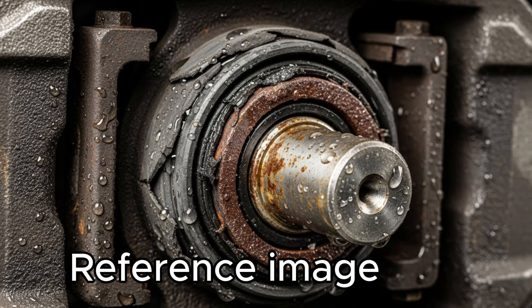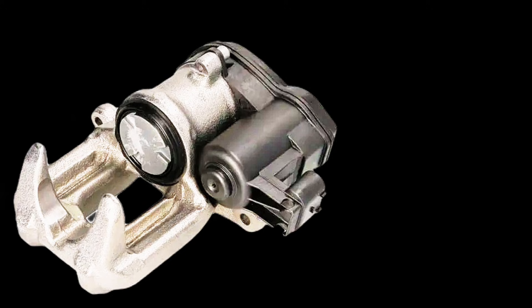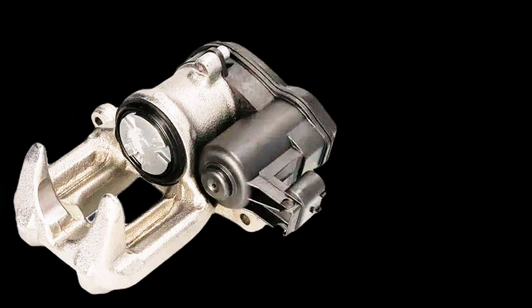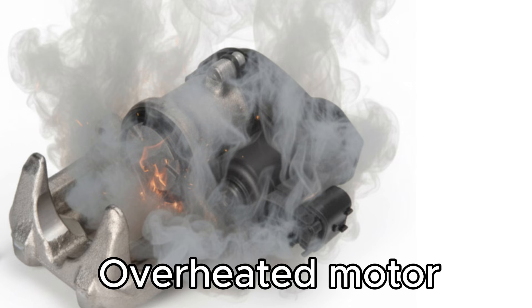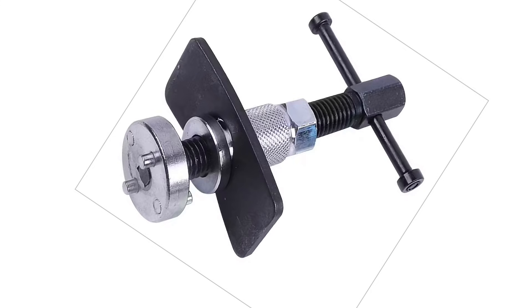You can get a bit of water in — as shown in this reference image — and then the piston can get stuck. But on this particular car, the piston was okay. The issue was the motor itself. The motor itself had become stiff with a lot of resistance for whatever reason. So when you've got 12 volts in and a ground, that should make it move, but it can actually overheat and then the system will detect a current overload and switch it off.